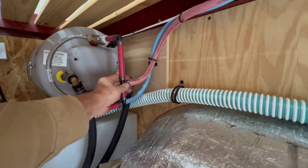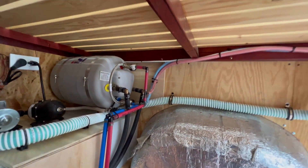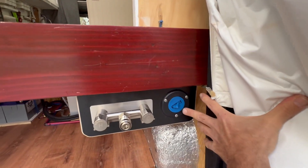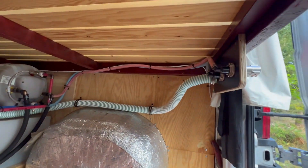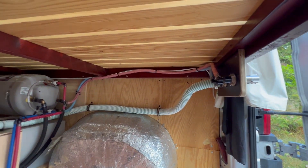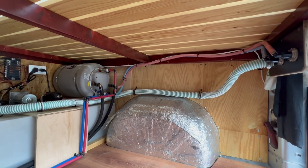Here you can see I worked in the vinyl braided hose because I'd been wanting to use it. I see these manufactured RVs come in where they take a nylon braided hose and use a PEX ring on it. In this situation I used that approach to get to this shower panel the client wanted — so now he has a place to fill and a place to shower out the back doors. I ran that hose as a test to show how easy it is, and with PEX I would have needed at least four right angles to make it look nice. Plus, this is in a highly accessible area, so if any leaks develop at the fittings, they'll be easy to reach.